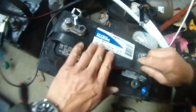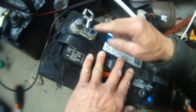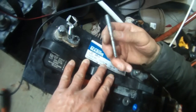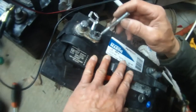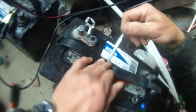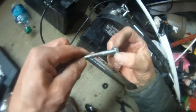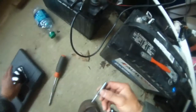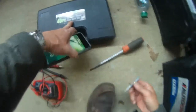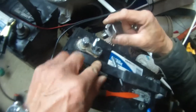I'm going to show you one more time. This terminal that came with the battery looked like this, except it was 5/16 inches, but it broke and came off. So I had to use this screw I had lying around. I drilled a hole in between here and then screwed it down, but the thread was not correct for 5/16 inches, so the nut wasn't able to fit. So I had to use the die and tap set to die the thread to 5/16 inches.